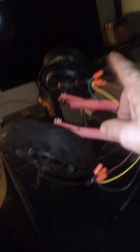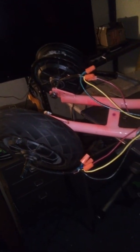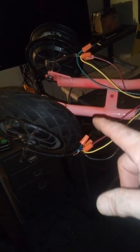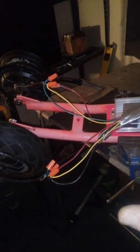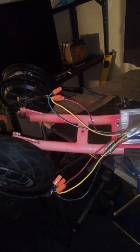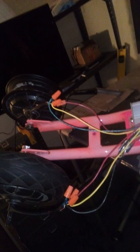My problem with the one-motor scooter is that from a dead stop, when there's a big load on the motor, it does this clipping thing. It's an identical motor without hall sensors. What happens is the controller, as I hit the accelerator, sends out sine waves that ramp up really quickly. With my weight on the wheel, the wheel can't keep up with the sine waves being fed to it — it's not in the position it's supposed to be to receive each sine wave, so it hesitates and clips, like clipping with subwoofers or a Class D amp.